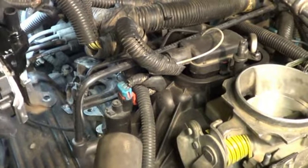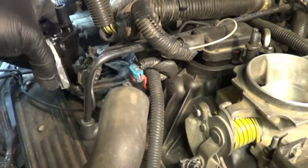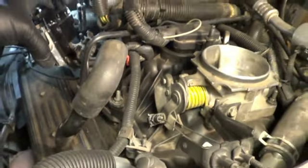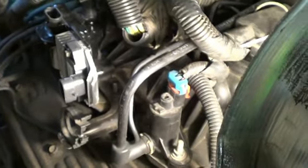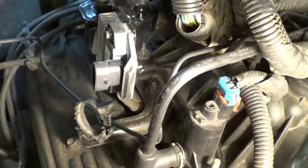So there's a top bracket that was held on by nuts. Yep. So we're putting that coil back in with two studs. So we'll get those two studs holding the coil down, then we'll slip the bracket over the top of it. So we got those two studs tightened, coil's being held pretty tight, so now we move that other bracket into place over the top of those two studs, and then there'll be a couple of nuts that go down over the studs and hold that bracket into place. We've got that bracket held down with two nuts over the top of those studs.